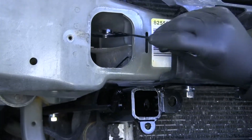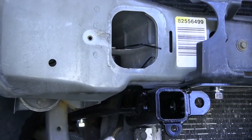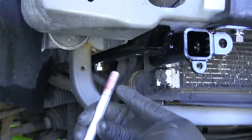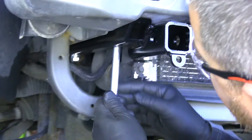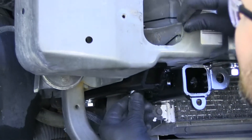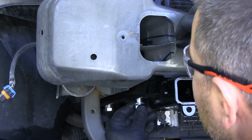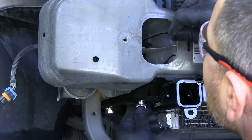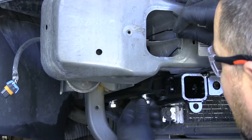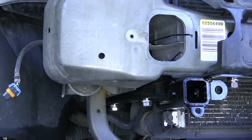Slide our spacer into the hole where our second hole was drilled. Take our square nut plate, then the five inch half inch hex bolt with lock washer — make sure you put Loctite on it. Go up through both of them and thread it right into our plate. Again, we're not fully tightening these — just hand tightening them right now.